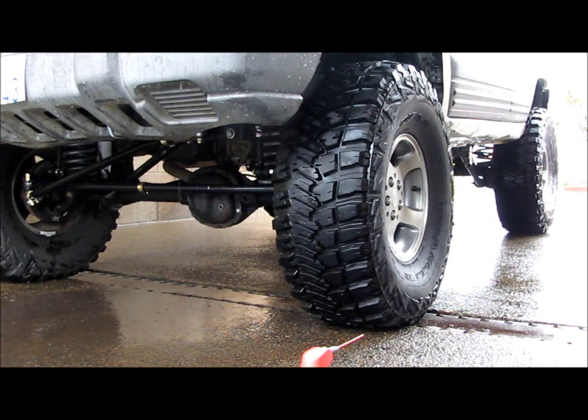It's almost like you're on a rollerblade wheel or a little skinny bike wheel instead of a big nice square bottom tire. So when you don't have much of the tire on the road, you're going to notice your handling sucks. The slightest input, you're going to skate that way. The slightest input back the other way, you're going to skate that way. So what you have to do is just air your tires down until you're getting a nice contact patch.